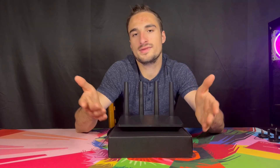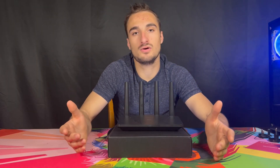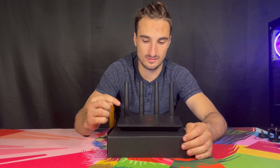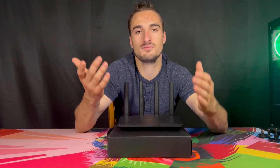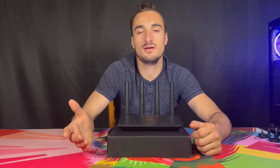Now you've got it set up — let's talk about what this actually is and what it does before we get into whether it's worth it and what the speeds are like. It's Wi-Fi 6, which is the IEEE 802.11ax standard. The IEEE 802.11ac is the Wi-Fi 5 standard. Wi-Fi 6 is backwards compatible — not Wi-Fi 6E, but Wi-Fi 6 which this is — backwards compatible with other devices on 2.4GHz and 5GHz. The AC is not backwards compatible. What Wi-Fi 6 does is it has added security with the new WPA3 standard, which you can enable on the dashboard as shown in the video.